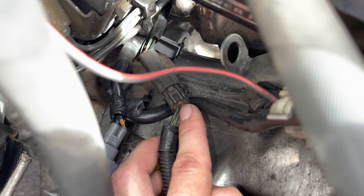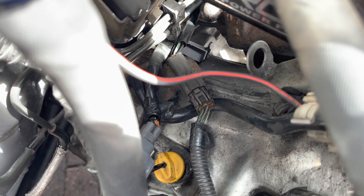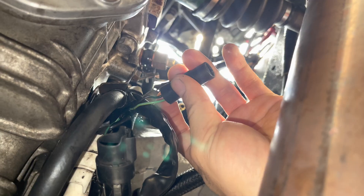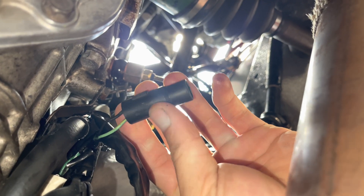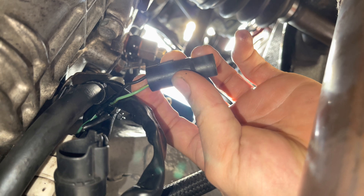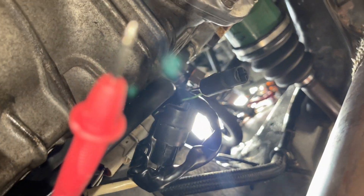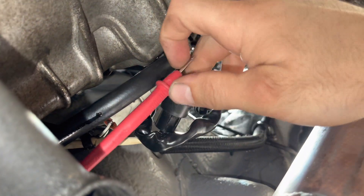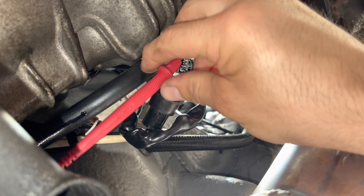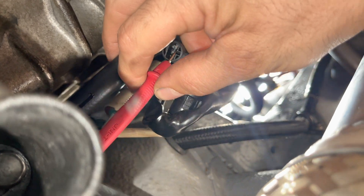The wire color that connects to this one is actually black. The green wire is obviously the reference 12-volt feed. This black wire is the actual signal that goes back to the ECU, so the black wire is the one we want to check for continuity. I'm going to test the black wire on the neutral position switch connector we unplugged. If this beeps when I put it on that pin, we're in business. There we go — we've got continuity.